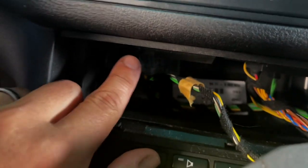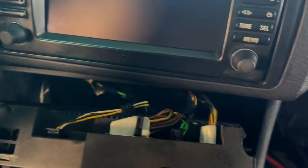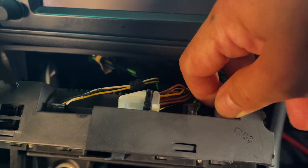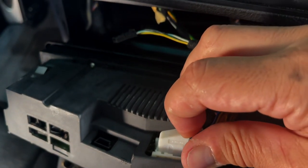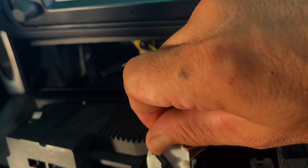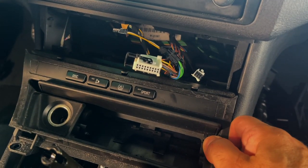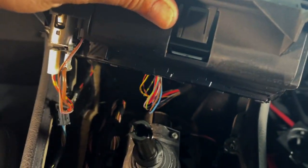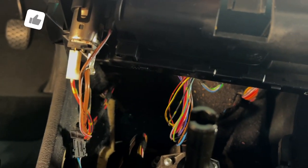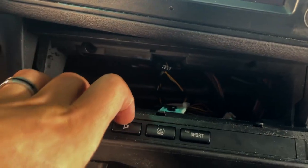So with that out, there are two screws — one up here and one on the other side. Now with those screws out, in order to get this through there, we're going to have to unplug everything from back here. This one here — you just push down in the middle, there's a little tab — push down and then you can slide that over and it comes out. It should be free other than unplugging the cigarette lighter and these here. Lift up from the bottom and then you can see everything else that you need to unplug. If you have buttons here, you're going to want to unplug them as well.